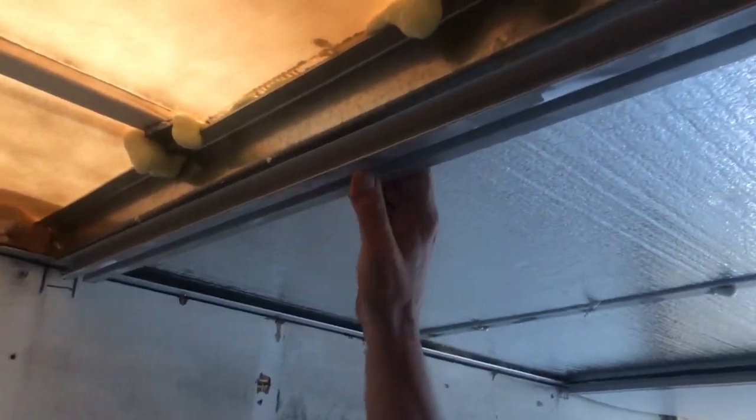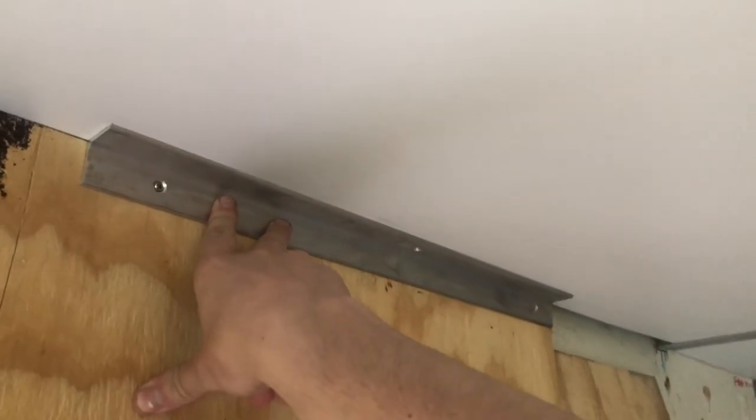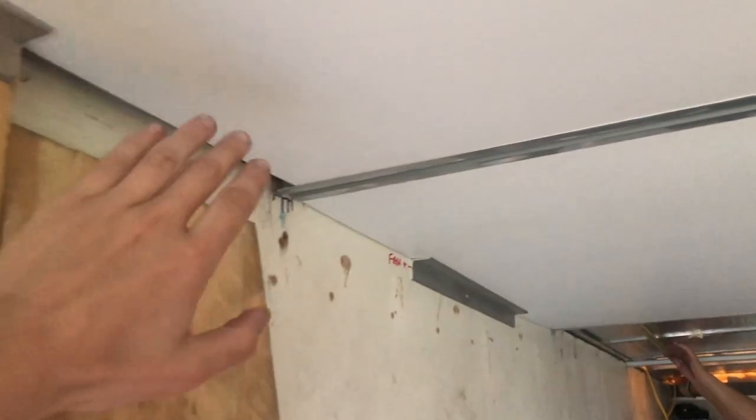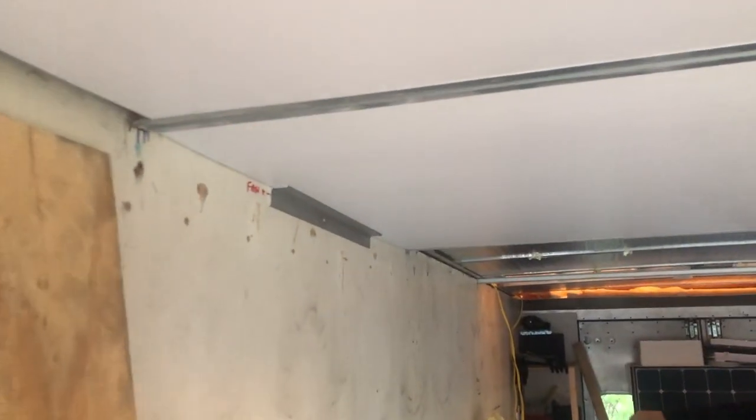So what are you doing? We are hanging up extruded aluminum pieces that are going to capture the ceiling panel. This is the ceiling — we glued aluminum reinforcements to help keep the PVC from flexing as much as possible. This side is going to be the side we see. We have some supports up there temporarily until we mount the ceiling cabinets, so the flushness won't matter. There's a little gap here, but rather than cut it out we're just going to cover it up.